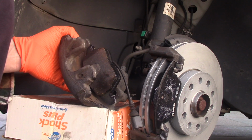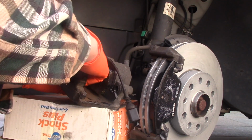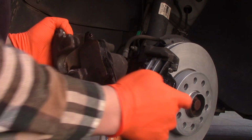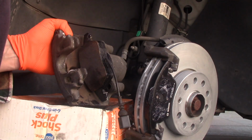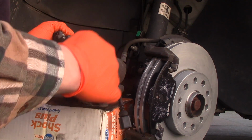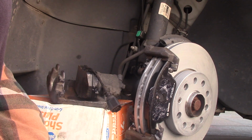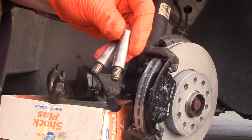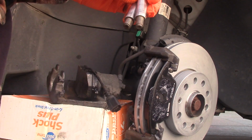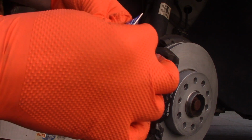Finally, adding lubricant on the dip inside the caliper, the small dip. That's where the ear sits. And on the sides. Sides of the caliper will touch the brake pad. Let's lubricate it over here. And the caliper pins. Those two, I already cleaned them. I'm going to be using silicone paste on them. And on the thread, I will add this medium strength thread lock.